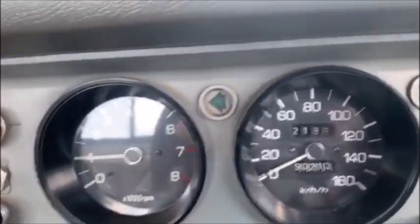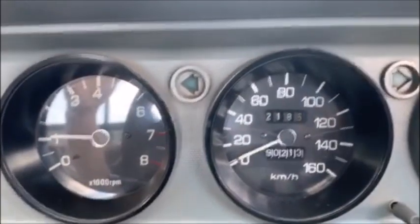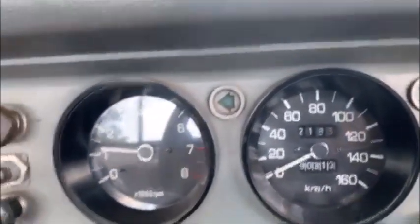And interestingly enough, after I changed it to the F66, it still had a bit of a flat spot, and I went one size smaller on the mains and it was worse. So then I went a size up, actually two sizes up, and then it was fine. So this is the test after I changed the emulsion tubes and the jets. Idling like this in gear and press the throttle, it had a big flat spot. But I think I've sorted that.